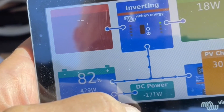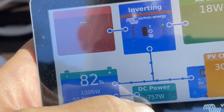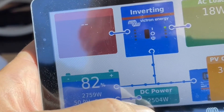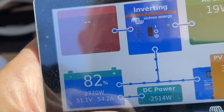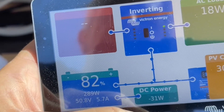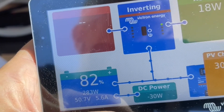Now we see the power starting to increase, slowly winding up until we get to 2500 watts — 2308, 2506 is what we've got set as the max in this car. Now let's take the revs back below a thousand. We've gone back below a thousand and look — it's turned off. That is the compliance to Euro 6.2. How good is that?